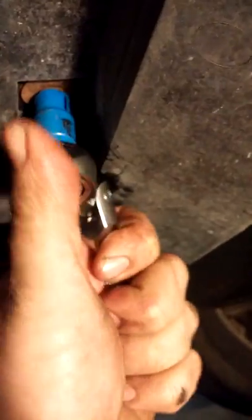I want to show you all a little trick — there's this little plastic guard right here. If you take it off, take those bolts off right there, you'll be able to at least see back inside here, which helps just enough to put an extension and your sockets and ratchets together and help get these from a different angle. These are 10 millimeter. These little stubby ratchets come in handy — you don't necessarily have to have an extension because these little flex handle stubbies work wonders. Then you work it out back and forth and pop that off. You'll actually be able to see it a whole lot better — right there is what you're looking for, there are the fasteners, there are the lines, and you get a clear shot.